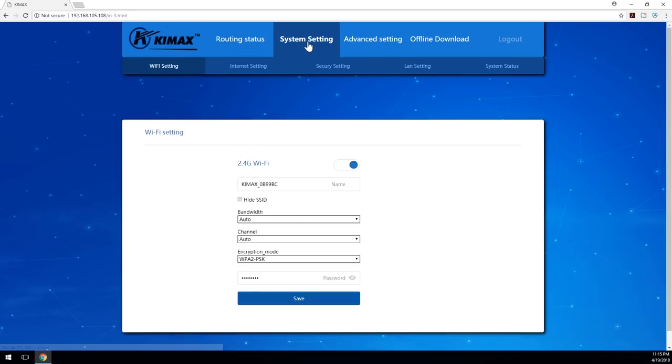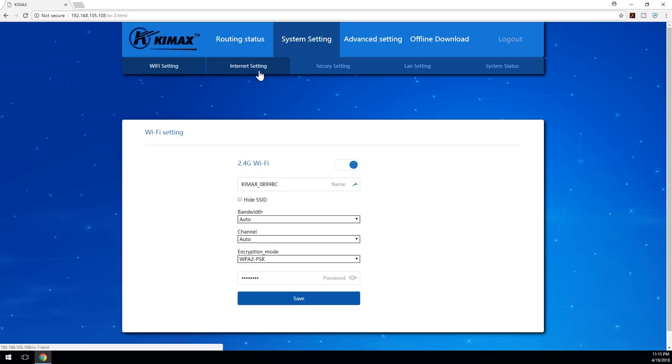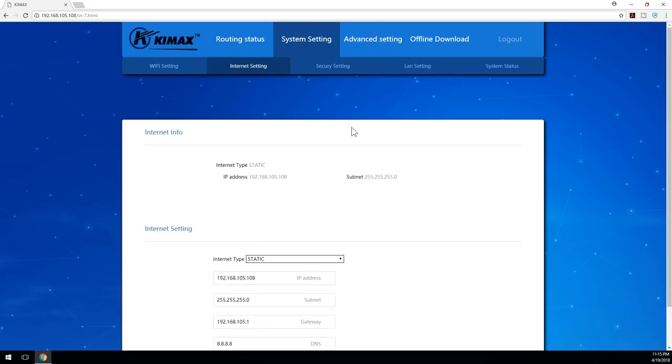That's my only pet peeve — why wouldn't they install a formatting tool? As far as system settings go, there are Wi-Fi settings you can configure. This device can actually be used as a router — you can plug your WAN into the ethernet port and have it route your Wi-Fi network traffic. You can also set static IPs here if you have it connected to a network.